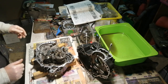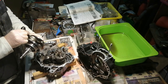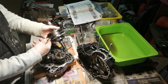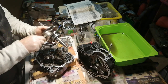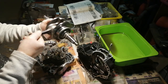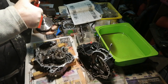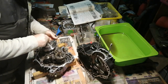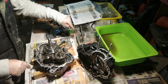First I need to put the crank in. You don't want any play this way at all — up and down — and you're allowed up to about eight thou, 0.2 millimeters, from side to side. You can feel a tiny bit of movement side to side but nothing the other way — absolutely nothing. A little bit of oil on that, a little bit of oil on that. I'll make sure the conrod is sticking out the top.